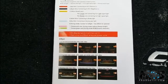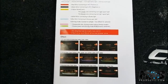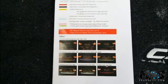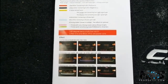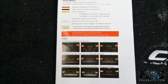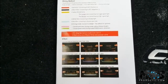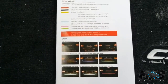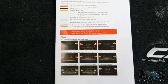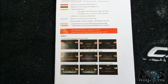The white wire is going to connect to your brake light. The blue wire is going to connect to your reverse gear light, but in some states — like right now I'm in Massachusetts — you can't run blue lights or ice blue lights on the rear of the vehicle. So what I did, I switched them up: I switched the blue wire for the reverse, which is actually a white light, and connected it to the driving mode taillight so that when I'm driving it's white versus ice blue.